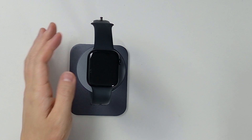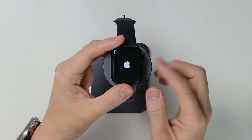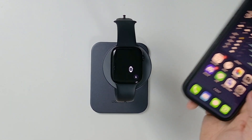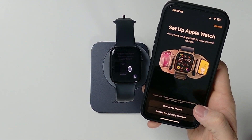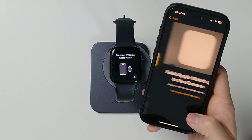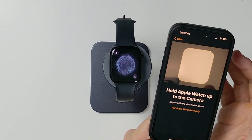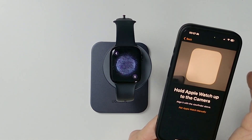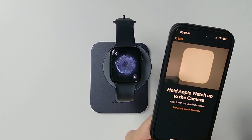If I look at the actual Apple Watch that we're trying to reset — I'm just turning that on now to show you what's going on. This is now resetting. I'll put this phone next to the watch to show you what it would be like if you're trying to set this up for yourself or for someone else. This is saying we can set it up for myself or for a family member. We'll pair this on our phone as if we're a new user. If we didn't do this properly, there would be a different message here saying that we needed to remove this watch from the activation lock on our iCloud account. But since we removed the iCloud account correctly, we don't have that error message anymore.